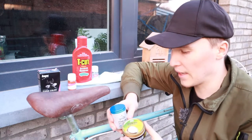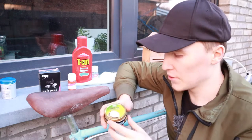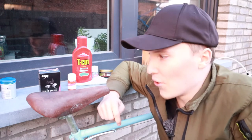The Gatsby B and the Cocos hair wax — in the end I liked the Cocos one better. It was a bit more shiny, and when you go over it the saddle is now nice and smooth. Make sure that if you don't want to go with the quite pricey carnauba wax or beeswax, you can use a hair wax, but make sure there are not too many ingredients in it — otherwise it might not work. I'm glad it did. I hope you liked this video — if you did, please smash that like button and subscribe to the channel for more bicycle restoration and vintage bicycle content. Tell me in the comments if you've also restored old leather and what your tips and tricks are.